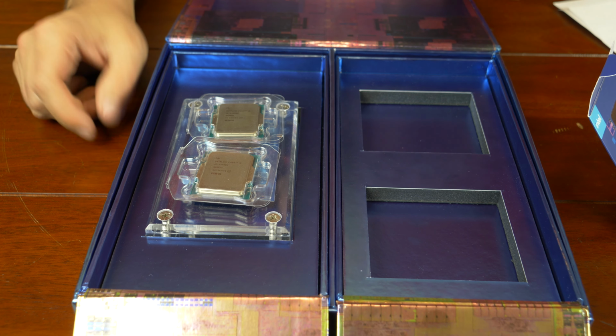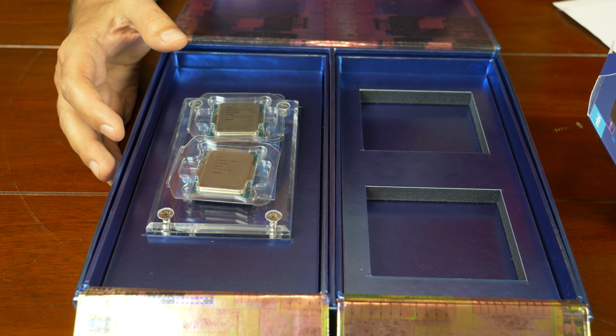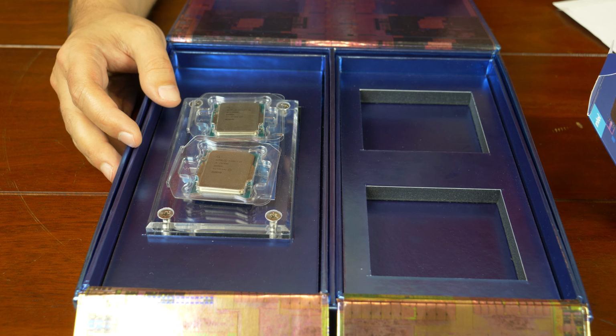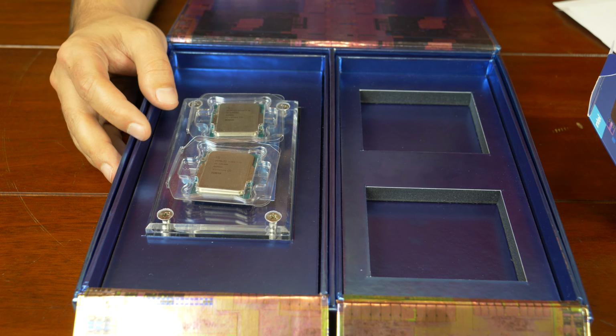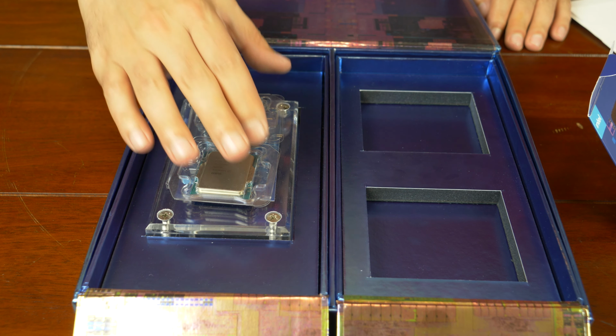So, I believe we're going to move on to basically testing and everything. These CPUs still have 16 lanes of PCIe 5.0. The chipset's really what's been enhanced. The chipset now has a lot more PCIe 4.0 lanes. It supports, I believe, up to five 20Gbps USB 3.2 Gen 2x2 ports. And yeah, so that's the improvement you get with Z790. But yeah, same LGA socket.